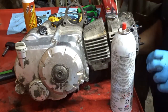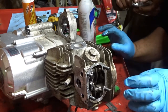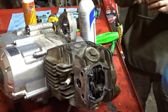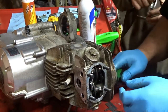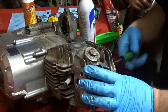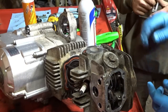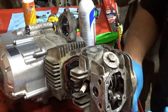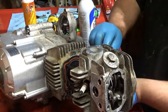Okay, you let that dry just a little bit. So this is where it's going to get confusing for a lot of you guys, and I'm going to try to explain it to my best. Son of a biscuit — see, this is what happens when you rush the job: you forget to put the timing chain roller in place. So we'll pull that back off. Don't do what I did — put the roller in place.